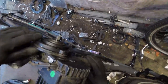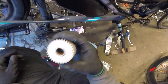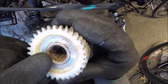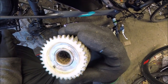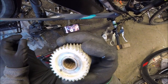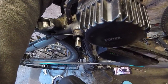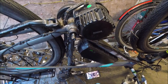I'm relieved that's fixed, because that was a right pain. So if it is slipping, this is obviously the issue — these bearings inside here. If it slips under power, the one-way roller bearings in the middle are what cause the slipping. I've not seen this mentioned on any other Bafang videos. In effect it has two clutches: this is what some people call a one-way bearing, a roller bearing, or a clutch bearing. There's this one in the plastic cog, and the bigger clutch which does the click with the pedaling. So in effect it's got two clutches. Problem solved — I'll stick it all back together.